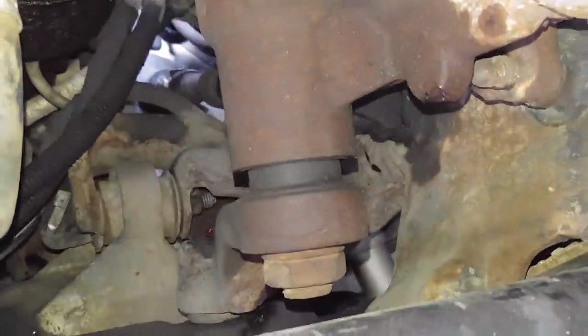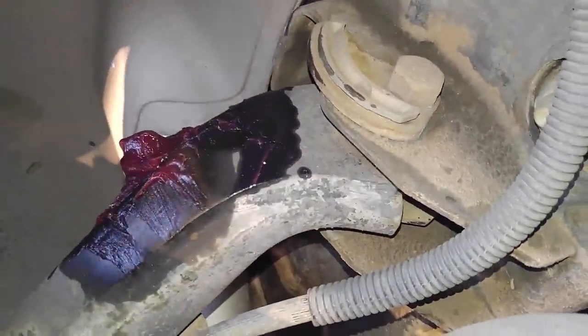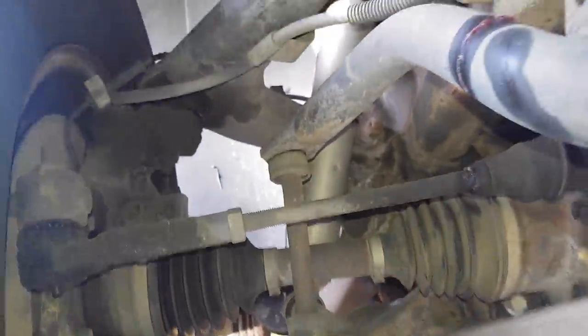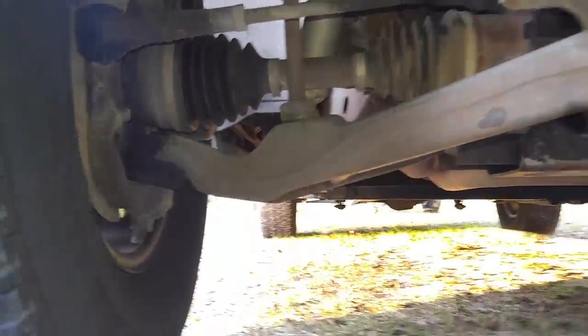Clunky, clunky, clunky. I watched a guy on YouTube rebuild a steering box, but it's a last-part-out, first-part-in syndrome. Maybe I can find a low-mileage one, and maybe one day I'll rebuild the steering box — never done it in my life. Over here on the tire, the camber adjustment just to the right of the grease fitting has to be moved. I'll do it when I do an alignment, because if you change the upper control arm position you have to adjust the tie rods. I'm going to jack this up and check the front end parts.